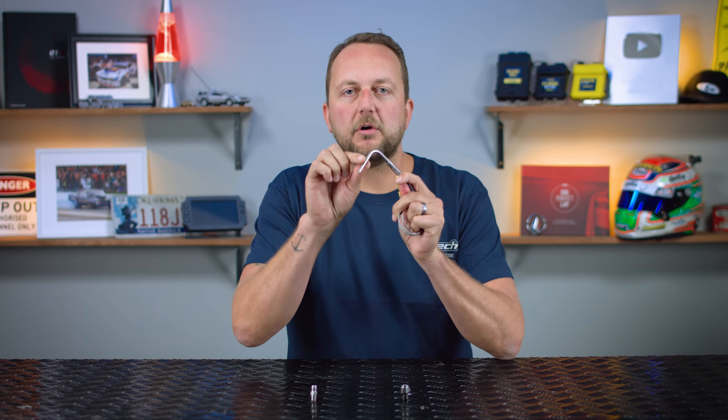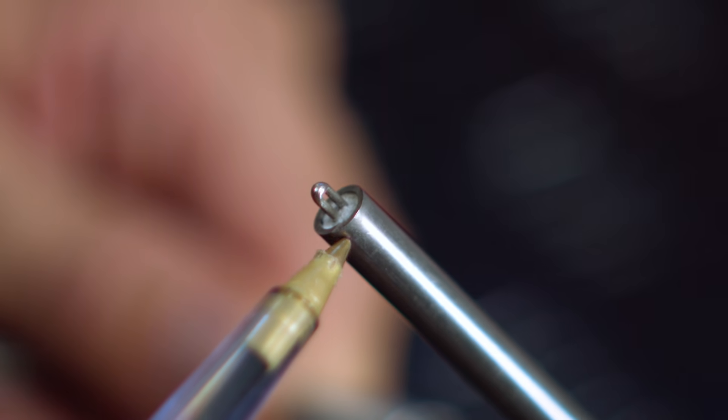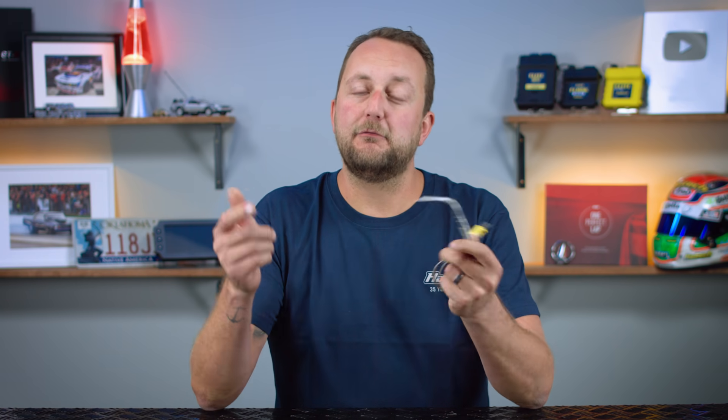The sensors come in a range of different physical appearances and shapes. The sensors used to measure EGT are typically a quarter inch in thickness and open tip, but you can also get them in an eighth inch open tip or closed tip. The sensor you choose would depend on your application, but typically a quarter inch open tip is most common for EGT. The difference between an open or closed tip is in response time and reliability: an open tip sensor will react to a temperature change in around 200 milliseconds, while a closed tip sensor will react in around 800 milliseconds — a little slow if you're looking for rapid changes from something like an ignition misfire. You can also get K-type thermocouples that look like a little washer, perfect for fitting under a bolt head to measure surface temperatures. A one-eighth closed tip sensor would be perfect for measuring fluid temperatures, because you wouldn't want to submerge an open tip sensor for too long.